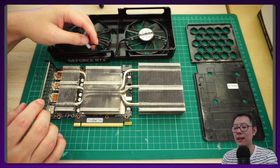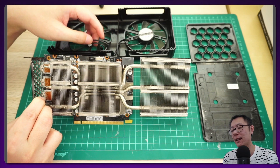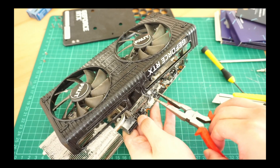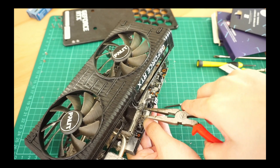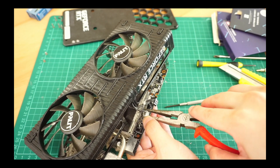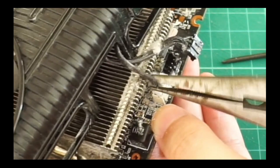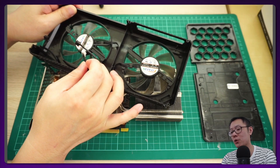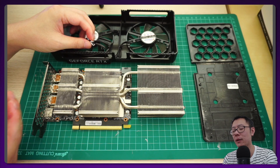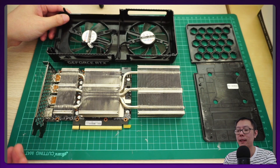The problem I had was with the fan header right here. It's really close together, so it's very hard to get your fingers in to disconnect it. I tried using my fingers, then a pen to lever it out, and finally settled on pliers — and that was my big mistake. I tried to wiggle it out with the pliers but slipped and cut the two cables on the fan header. The cables are so small it was almost impossible to fix on my own, and it was cut clean, so there was nothing else I could do.